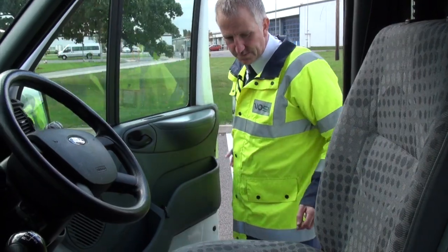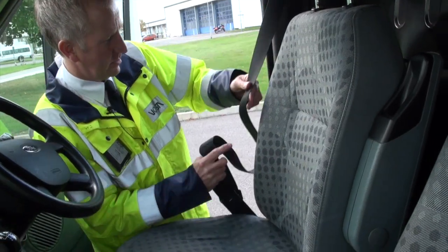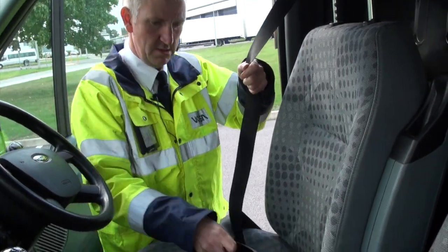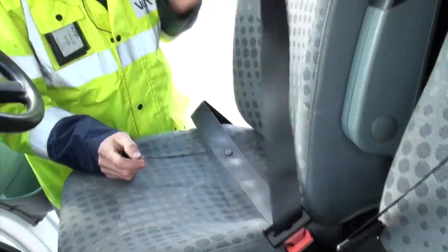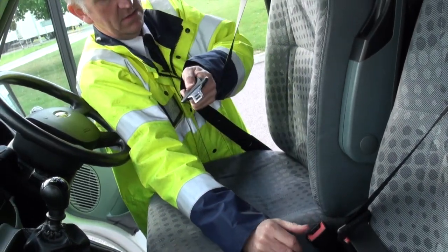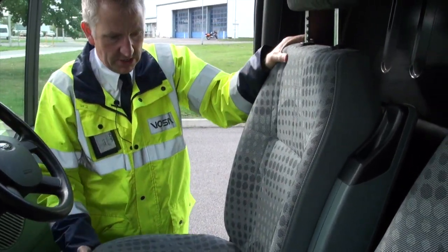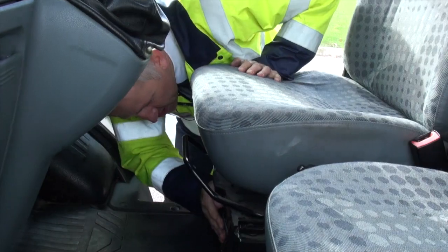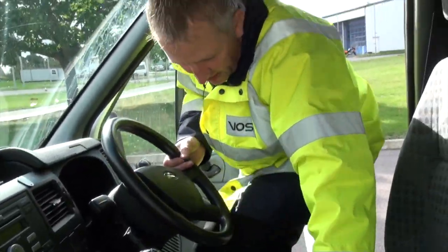Check the door as we open it — a good place to check the seat belt. We need to check the whole of the webbing, so we'll reel it all out, looking for cuts or damage. Plug it in and check that it retracts on an empty seat, and that it will come undone under pressure if needed. Check it retracts all the way. Check the seat for security — on this vehicle the battery is under the seat, so check that it is secure and not going anywhere.